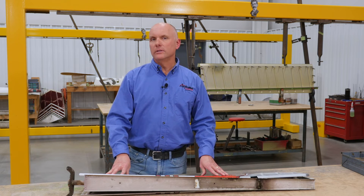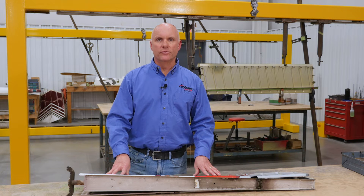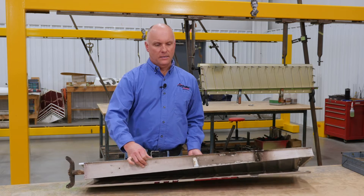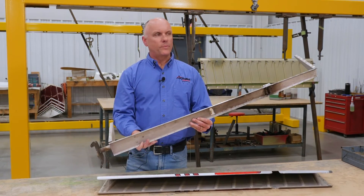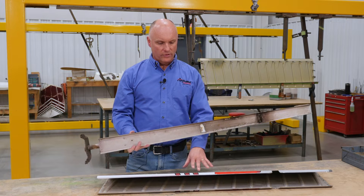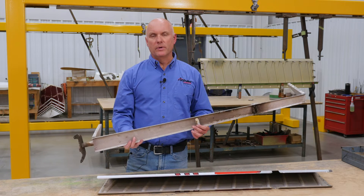The original rudders had the bumps-out skins, then they went to a bumps-in skin. Over the years they added several little doublers and improvements inside, but basically the rudder structure remained unchanged all those years. I have right here a conventional rudder. You can see it's just a simple folded skin — one spar with an upper rib and a lower rib. A very simple design. All the strength of the rudder is incorporated into the ridges formed in the skin itself — just the skin and a minimum of structure.